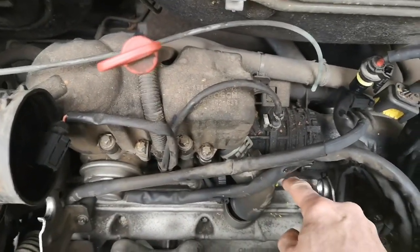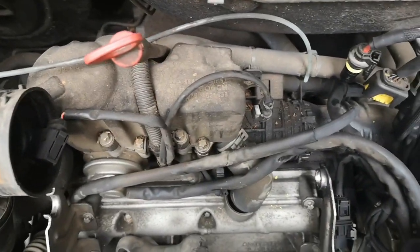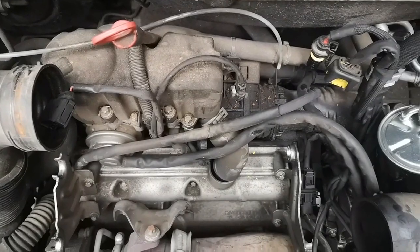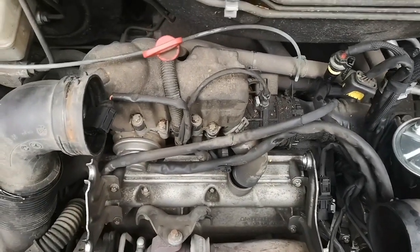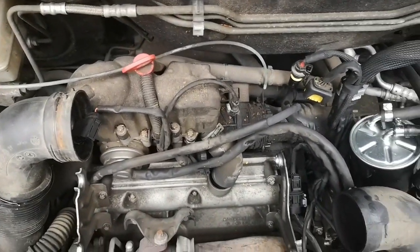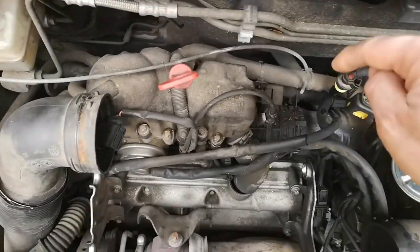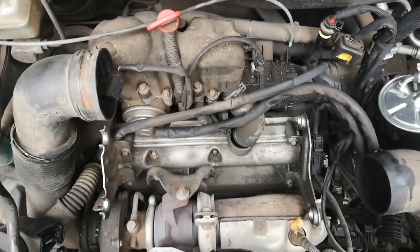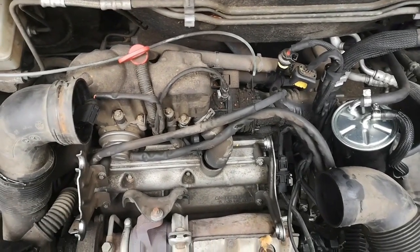This manifold arrangement also has to be removed to get to the glow plugs. While I'm at it, I'm changing the thermostat too, which is also down there. It's a very confusing engine — instead of a visible cylinder head, you've got masses of Mercedes pipework, like tons of spaghetti on top. Take plenty of photos if you do this job. That's where your Mercedes B180 CDI W245 glow plugs are — down the back. It's been a great car, but somebody was on something when they designed this.